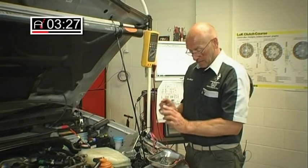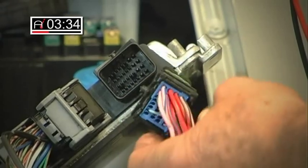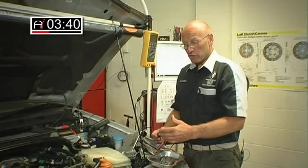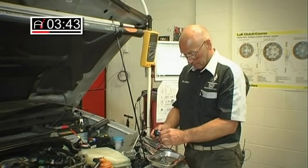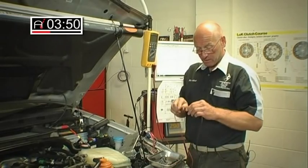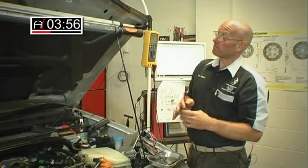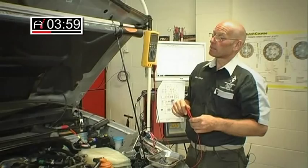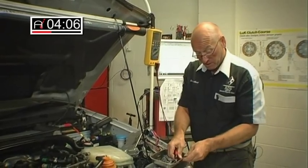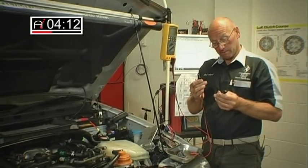The first thing to do now — and it's important when we're measuring resistance down the circuit — is that we must remove the socket from the ECU so the circuit is unique and not attached to any other component functionality. We have a multimeter, and I'd like to check the reference first. I'm joining both cables together to see the background value — we have 0.2 ohms. I'm using the same probes we use with the oscilloscope; these are 4mm banana plug adapters, so they're totally interchangeable.